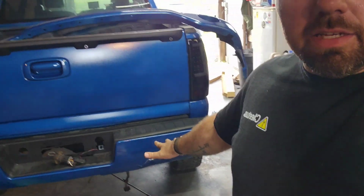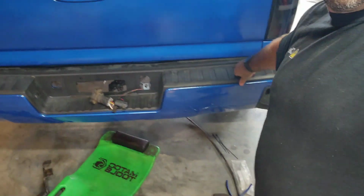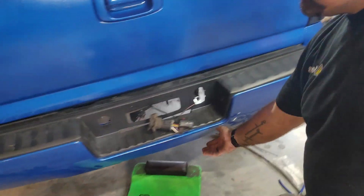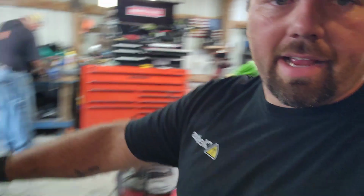We put a 2014 bumper on, and it is not extremely sound. See, it moves a little bit. The box didn't come with any instructions, and I didn't put two and two together when I should have, but we had to spend a lot of time making custom brackets for the corners here to even get it to mount up, because we have a 3-inch body lift with a different bumper back here, and none of that stuff's lining up.